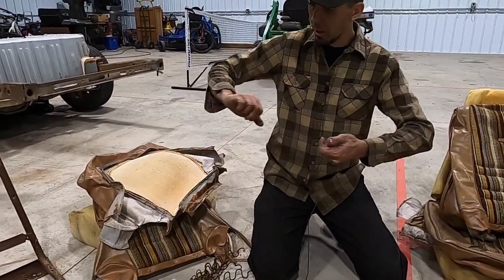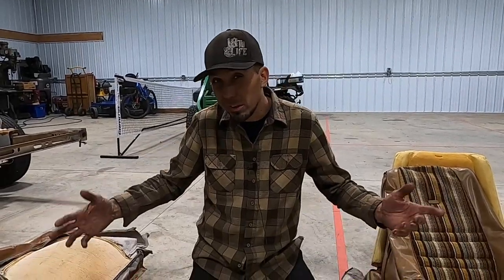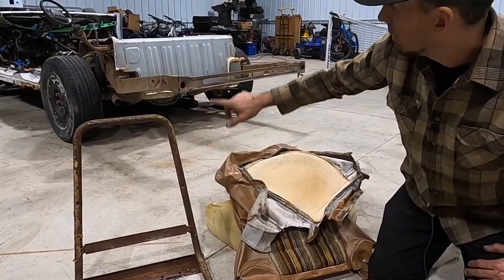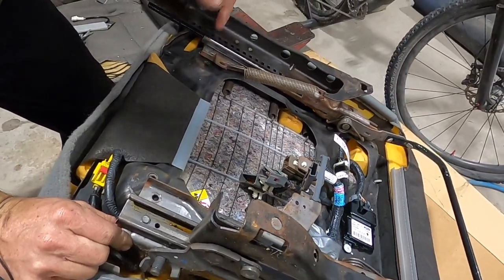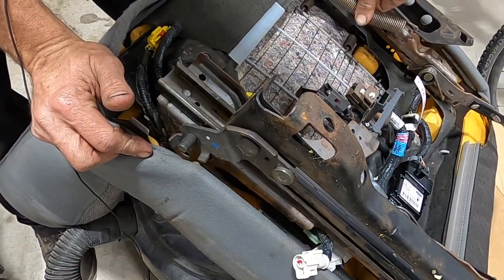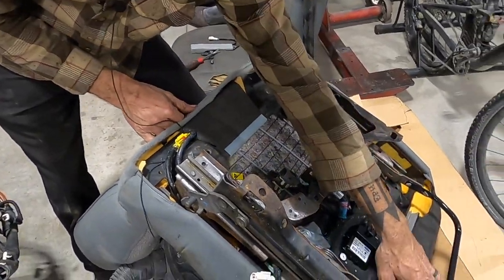There was one of the two seats that had kind of a twisted mat frame when it was removed. Somebody got a little bit carried away with tearing them out of there, so the seat frame was a little bit tweaked. But I got it straightened out as best I can, re-welded. What we're actually gonna be doing tonight is we're gonna get the seat tracks off of, actually just follow me, I'll show you. Doing a little bit of just unbolting where I need to, and then we may end up having to use the cutoff wheel or torch a couple things and stuff like that. But I want the springs, I want the action to be able to move, and obviously they're the perfect height to sit on the floor pan perfectly and being manual.